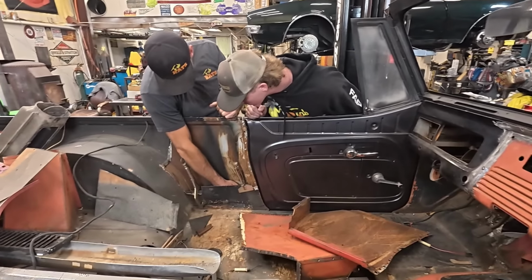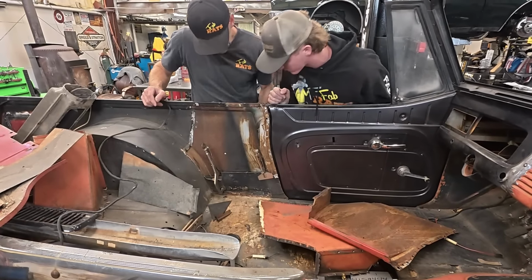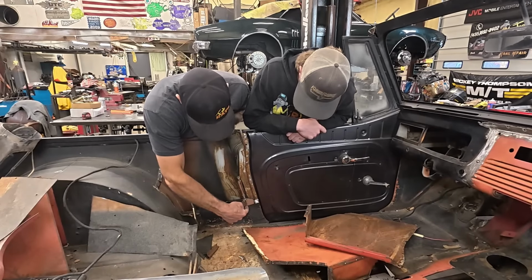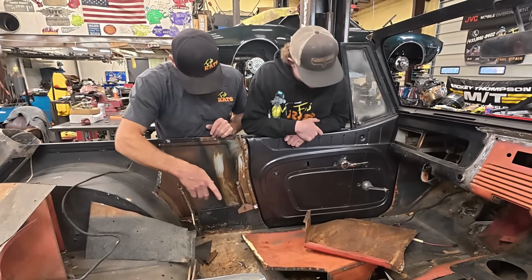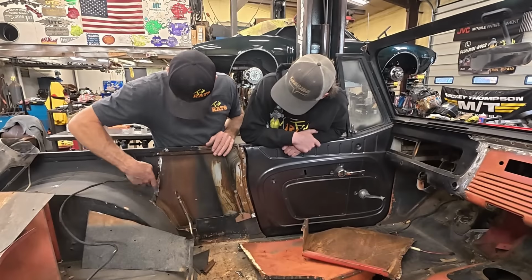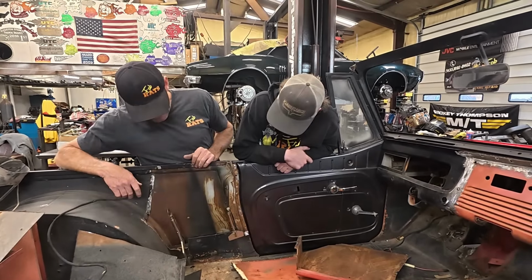The inside still needs to be pulled up and then tack welded so it doesn't rattle. Mm-hmm. Okay, so down in there. Yep, grind this and weld this seam, that seam. And then we should be able to set those over this. We'll grind this all up. Should be able to set it over it and weld the spot holes. And then that sets in here.